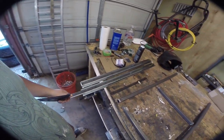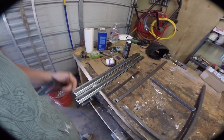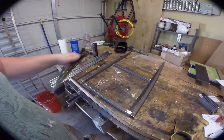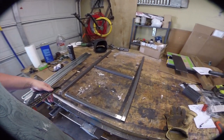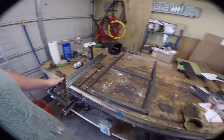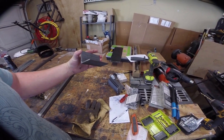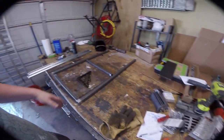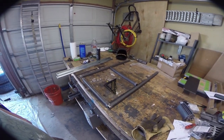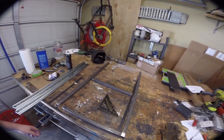The next little project we're gonna tackle is building the slide-out for the fridge. I have these really cool rails — about 80 bucks on Amazon, they hold 300 to 400 pounds, and the link will be in the Google Doc. Basically we're gonna build a 20-inch wide by 36-inch deep slider, mount it to these rails, and mount the rails inside the trailer using two-and-a-half inch 3/16 angle iron with M8 and M4 bolts. The whole assembly is removable and slides in and out the back real nice — gives us a place to put a fridge, a cooler, or whatever.